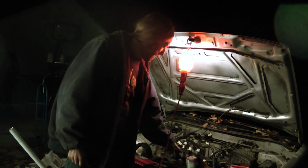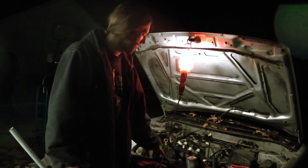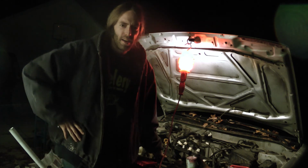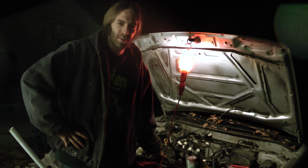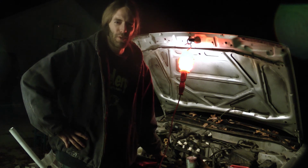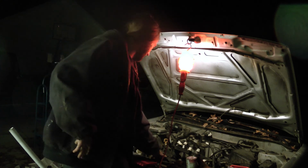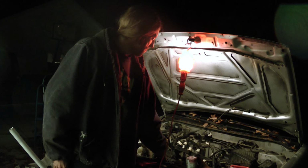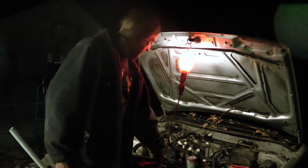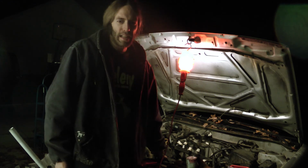Well, eventually what'll happen, it gets through the gasket, loses all compression, quits running. Their life force is dead. This is all because of envy. Cylinder 4 wants what Cylinder 3 has, and it's willing to do anything to take it, even if it means losing complete functionality, the complete force of what makes it work: compression. And I can see here that the gasket is indeed blown out between 3 and 4. So that's what happened. 4 was trying to get 3's SpaghettiOs. This is a clear case of envy killing something.